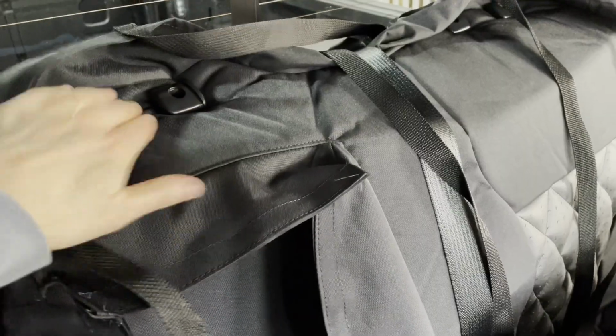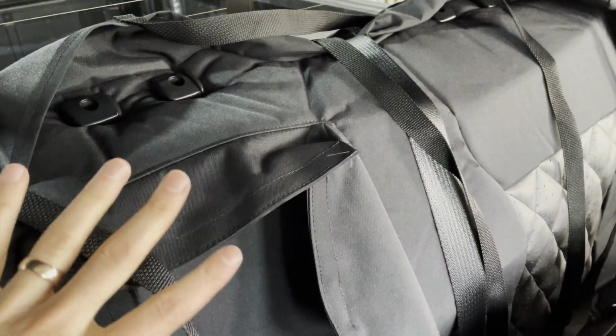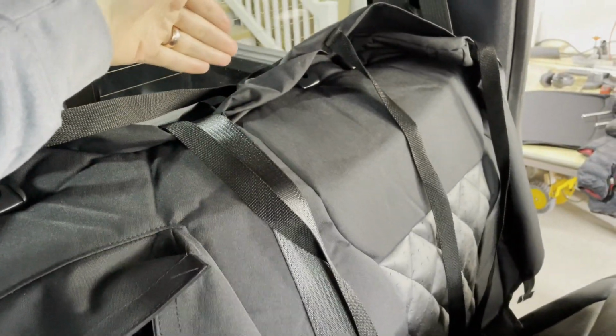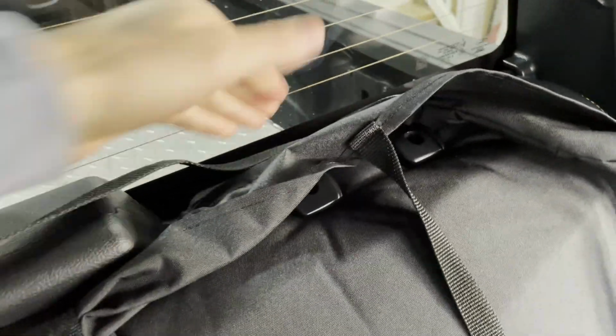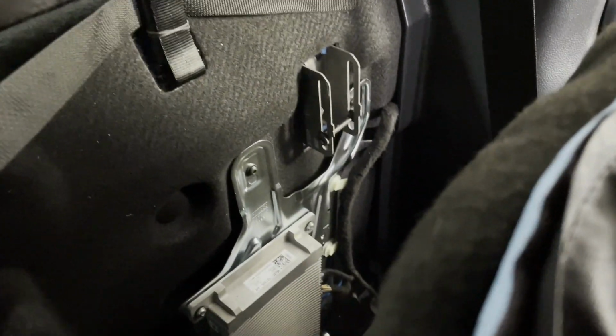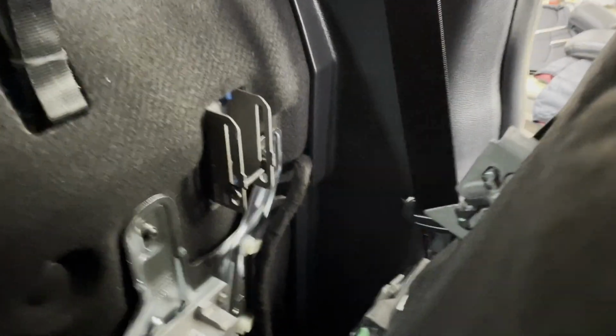Once you have these headrest posts in place, the next step that's really gonna make your life a lot easier on this install is if you reach behind on the back side of the seat, right in here. I'm gonna show you, there's a little trip lever, and I just pulled it just now, but I'll show you where it is, and then you can release this seat forward, okay? I know it's awesome when you can get this forward, because it's not designed for just the average consumer to, there's no pull tab for this, which I think Ford should have done.